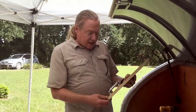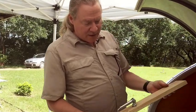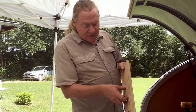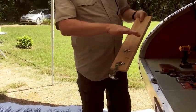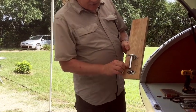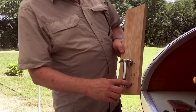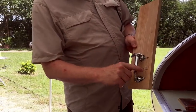Here's an example of the kind of latch we're talking about. I bought these from a seller on eBay. The way these operate is you just pull up on them, the latch comes loose, and then whatever you're connected to can be removed. As you can see on the wood, the distance between the screw mounting holes to get the right tension on the latch is three and a half inches.